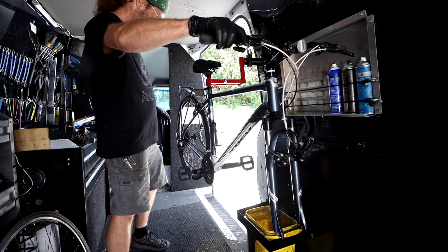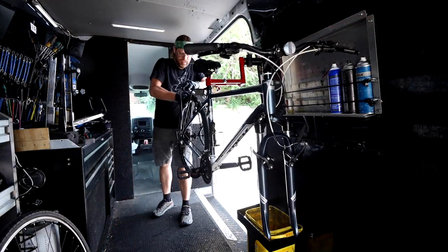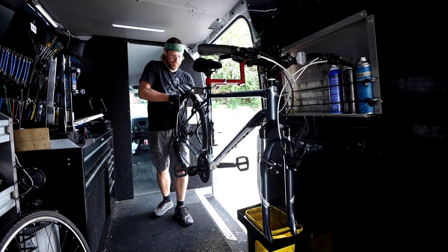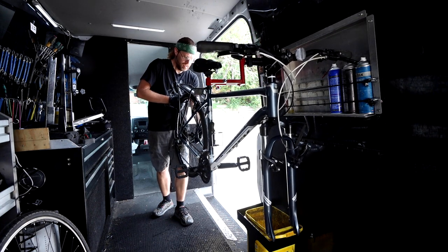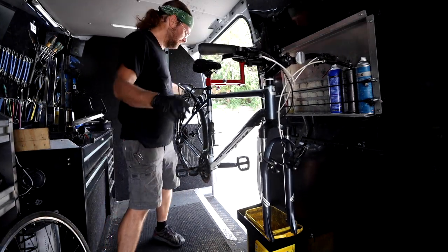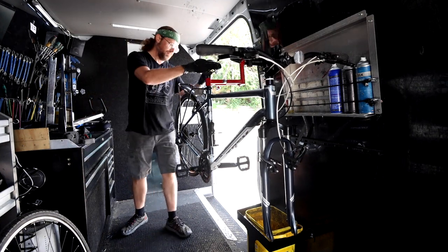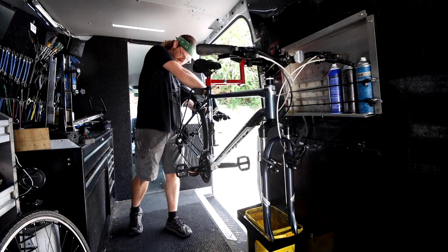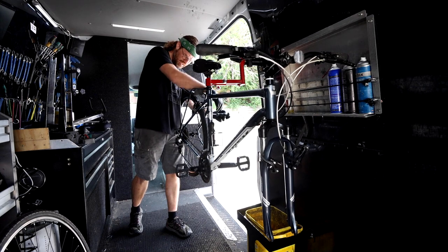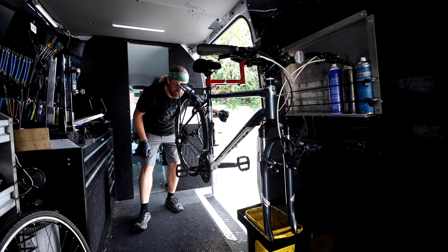I can see that this brake is only pulling from one side. Let me make sure the wheel is in all the way. We're going to make a quick adjustment to the brake spring — pull that brake over and look at my pads down here.